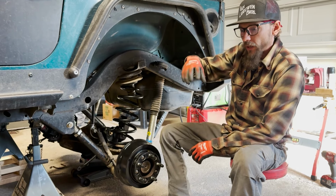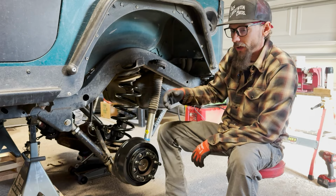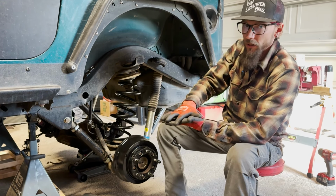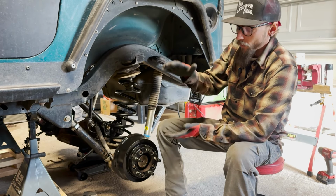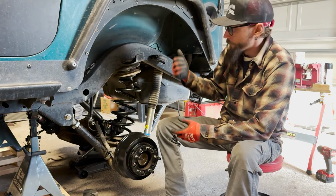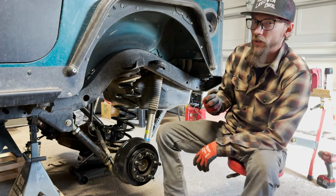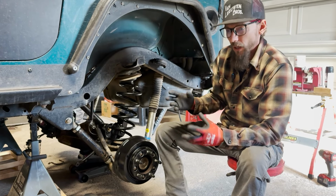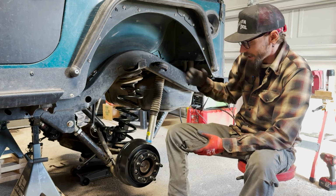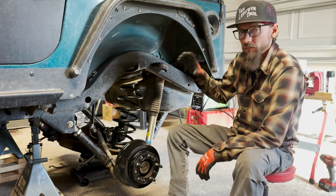And if you're running a dual rate, or which we were, I think a triple rate coil this last time around, I've got that entire top two sections smashed together already. It just doesn't ride very good, and then we're battling that recoil from the springs being over-compressed all the time from all the weight. So putting this thing on a diet and shrinking some of our gear load to get down to even less than we'll fit in the TJ.